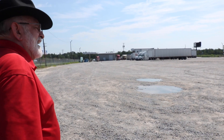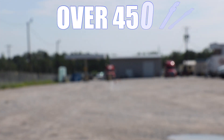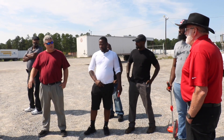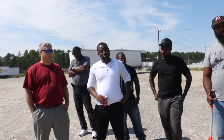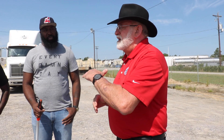Ideal conditions — the best it possibly gets — this is what it takes to stop the truck: 450 feet. And that's applying your brakes at full pressure, red lights and blue smoke stopping, everything you can to bring it to a complete stop. And that's fully loaded. Remember, light — empty, bobtailing — it's going to take longer. The truck is designed to carry weight; that's where it's most efficient in the braking aspect. If you're bobtailing, there's no weight on that fifth wheel at all — that back end just wants to get up and ride. A light trailer does the same thing. Your best braking effort is with a fully loaded truck. But by the same token, that's where you have your most momentum, because you've got all that weight rolling — and you've got to slow it all down.